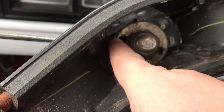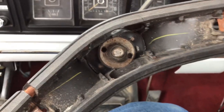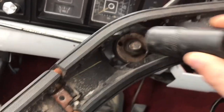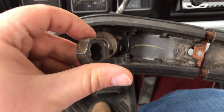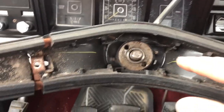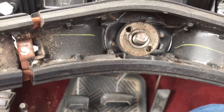The next step is to get this nut off, and these threaded holes right here you're gonna use your steering wheel puller on. I've got my socket on here — it's a 15/16" nut — I'm gonna zip that off right quick. Before I take the steering wheel off, I want to get it straight and make a little mark on this stud just to make sure I get my new steering wheel on there correctly.